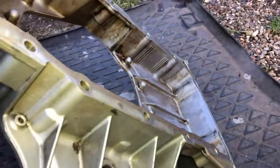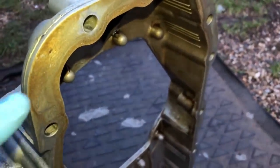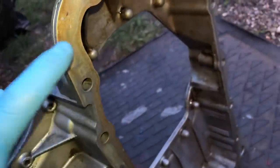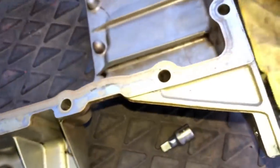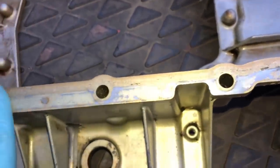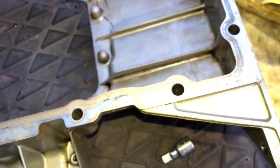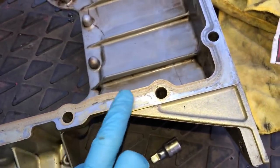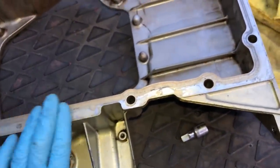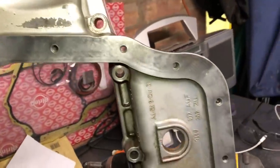I can see why it was leaking. This sump has been painted from a spray can, but they didn't tape it up when painting — you can see around here it's all got paint on the mating faces. As soon as it goes through heat cycles the paint starts to break off, so the gasket's not sealing anymore. We're going to strip it back to bare aluminium. Whenever painting sumps, always tape up the mating faces for the gaskets — paint the rest, but not those surfaces.